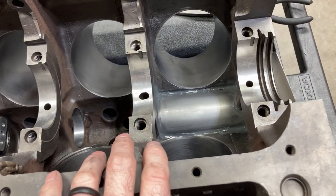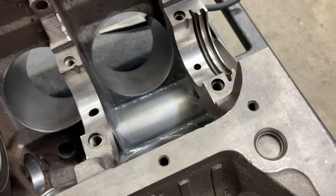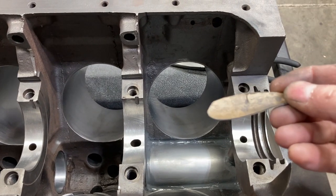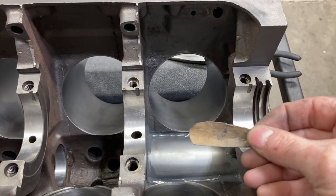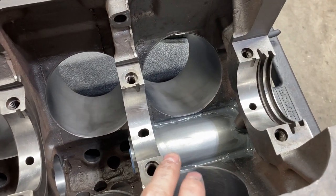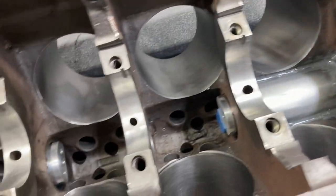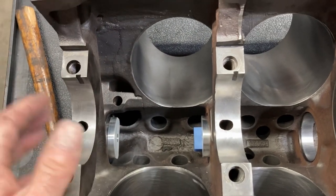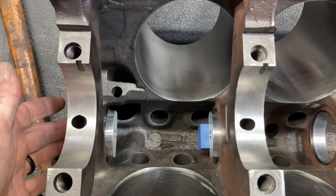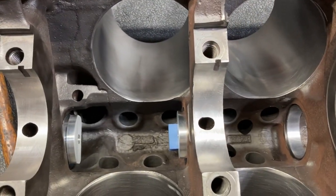I'm making some pretty good progress using JB Weld. What has helped me is mixing quite a bit of it and throwing it in there with my finger. Then I took a piece of cardboard with a rounded edge so I can just run it along the bead and smooth it out. It takes about four to six hours for this stuff to set up enough where I can go ahead and move my supports out. But I can jump to the front and start on this one. These are basically made to be collapsible, so when everything is done you can just knock them out and the aluminum pieces come out of the cam bearing inside diameter.